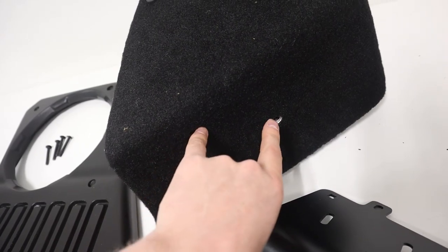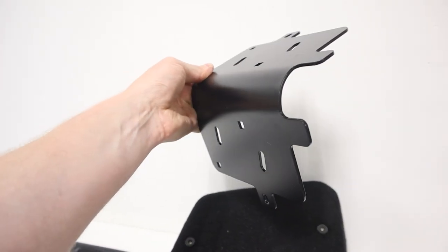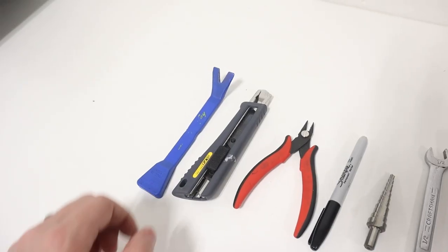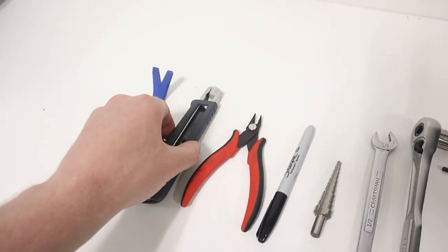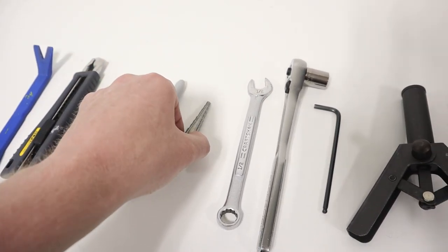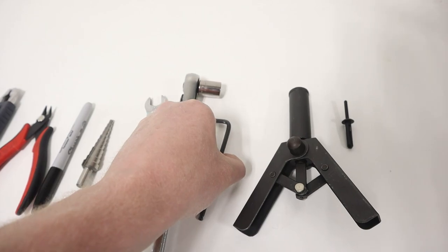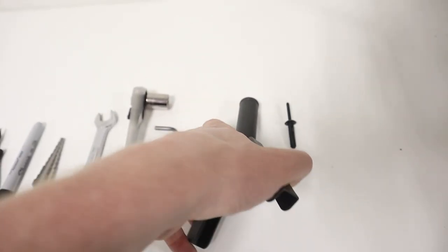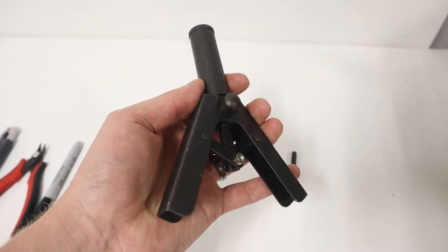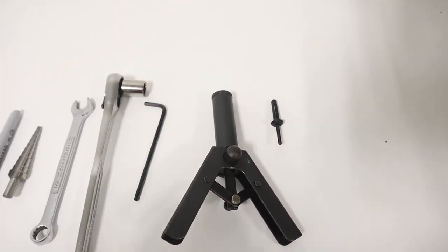There are holes in the bottom of the enclosure — these are what we'll be bolting to on this bracket, which is quite strong and robust as well. To install the Stealth Box we need these common tools and one unique tool: a pry tool, a knife, flush trim cutters, a marker, a step drill bit and drill, a half-inch wrench or socket, a four millimeter allen wrench, and a poly hand riveter. The poly hand riveter allows us to use a plastic rivet — more on where we'll use these later.